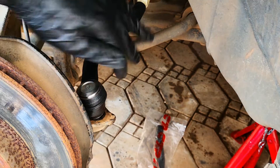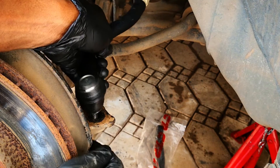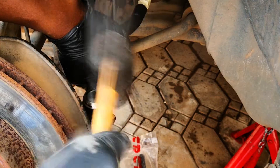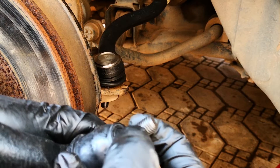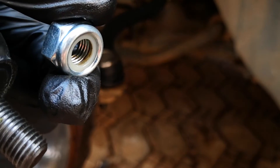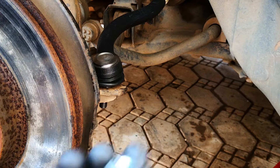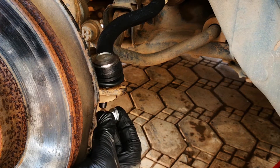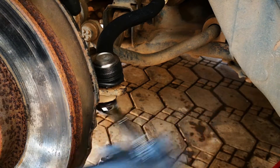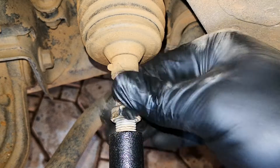That goes in, but it hasn't come out the other end yet. The new one is so stiff that it's not movable by hand, so I'll need to tap it with the rubber mallet. Okay, that's come through. I've observed that this brand has no hole for a cotter pin — instead the nut has rubber toward the end which locks it and prevents it from loosening. OEM doesn't have that. So this only goes in one way: the white rubber part stays under. Torque on this bolt is 44 Newton-meters. Don't forget to remove the tape and tighten the locking nut.